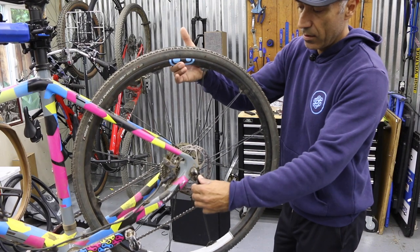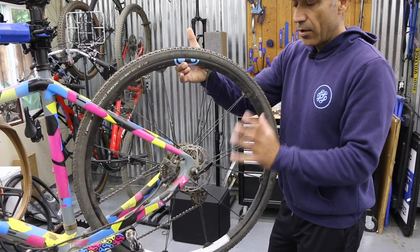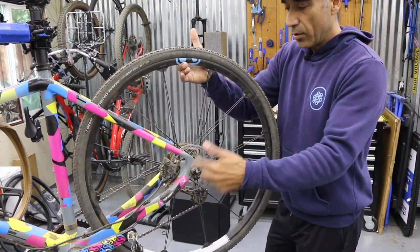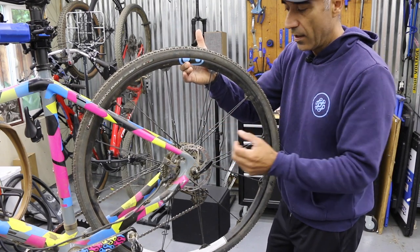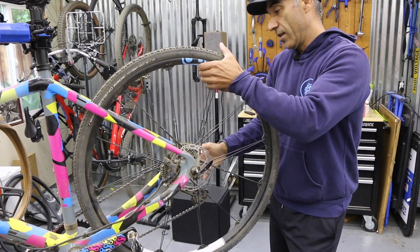Always hang onto the wheel, flip that open. If you've got a quick release in the rear, that's all you have to do. Flip it open, it's ready to fall. No need to loosen or unscrew it. You may have to do that with the front because the front has more metal and safety built into it, but not most rears. Actually, I haven't run into any that do have that.